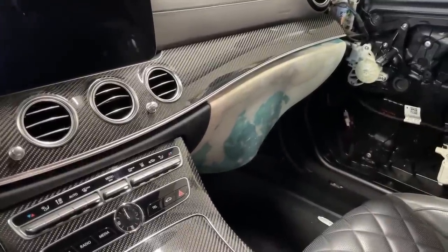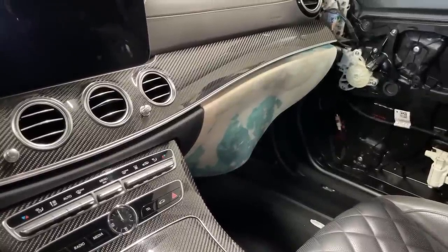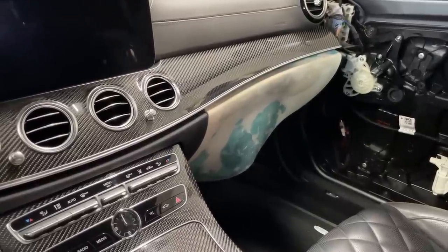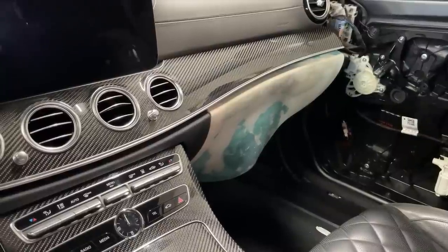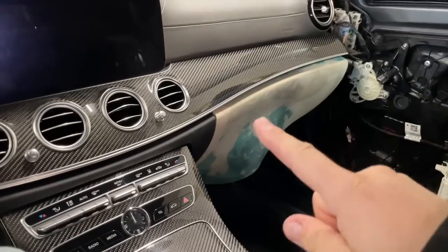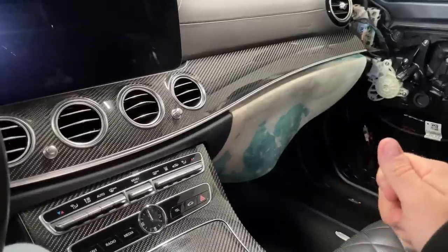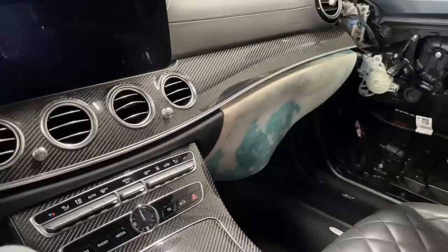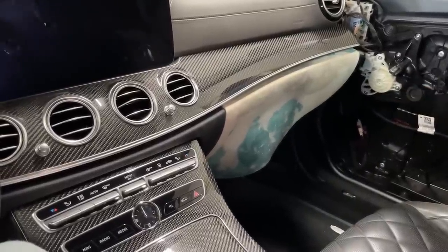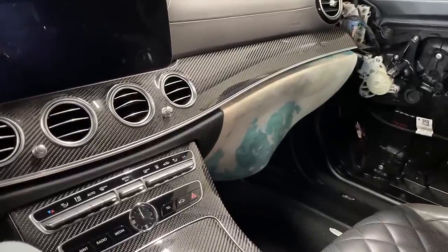Yes, definitely tricky. Many people could ask why we did the usual crazy puzzle technique, whereas many people could say that, oh, fiberglass would have been quicker, easier, the usual. It's one of those things that I just hate working with fiberglass upside down. I've done it billions of times, and in this car, the top section of the enclosure is quite deep. It goes quite far in, and you would have to do a lot of fiberglassing upwards, and you would have a lot of resin dripping and keeping the chop mat up on the top section as well would be quite a nightmare. So I started building the enclosure from those little wooden bits.